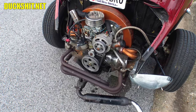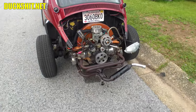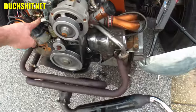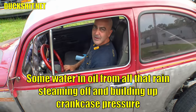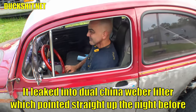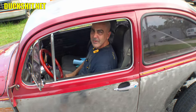It doesn't take but a few drops to get on the header to make a hell of a smoke cloud — it wasn't that bad to be honest. It's the dipstick for sure. Looks like we need to put a little seal on it — I've never seen one spit up through the dipstick before. That's probably the easiest oil leak to fix ever. You are going to need to top that oil off because you probably lost about a whole quart on the way here. Good thing you're only a few blocks from home.